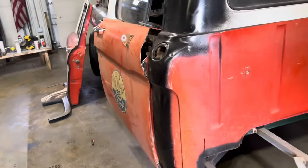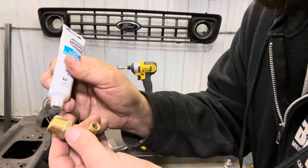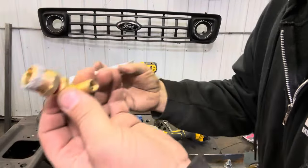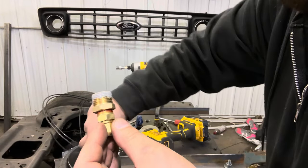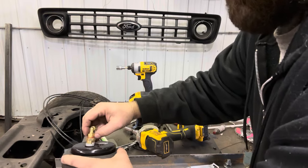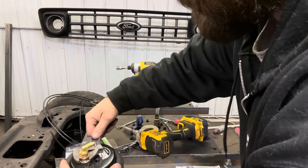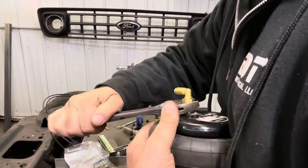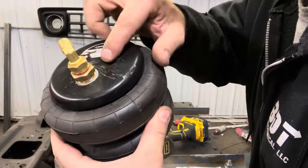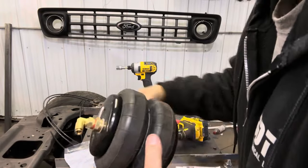It's close — real close. So here's what I do: put a little bit of thread compound all the way around. You don't have to go all the way up the threads — just like that. And what's nice about these fittings is you can swivel that 90-degree pretty much any direction. Run it in as tight as you can — yes, I'm using a crescent wrench, I shouldn't be, but I am. Get it fairly tight and you'll see it pull up around the edge a little bit. That's it.